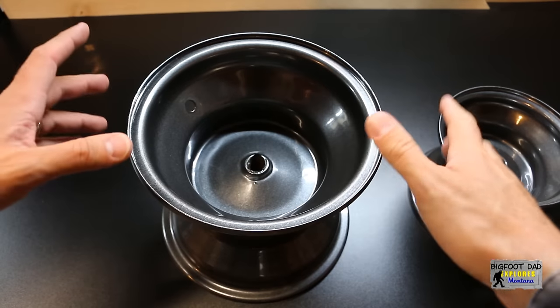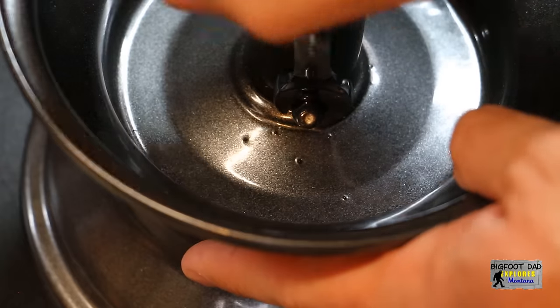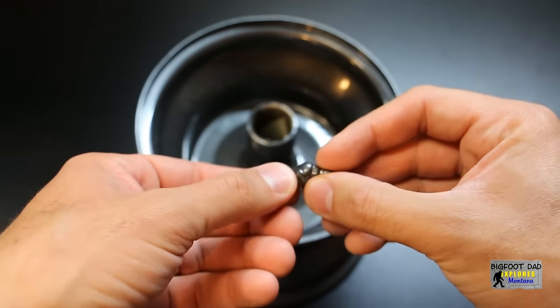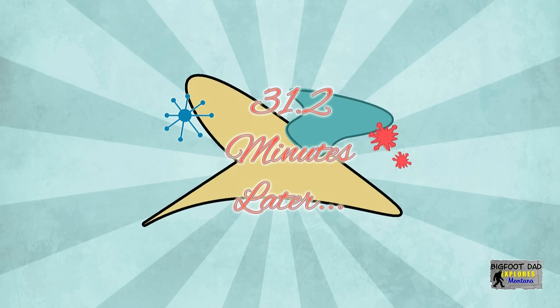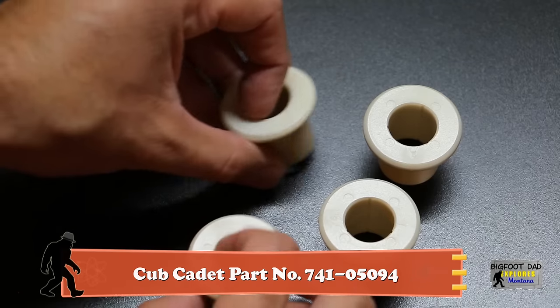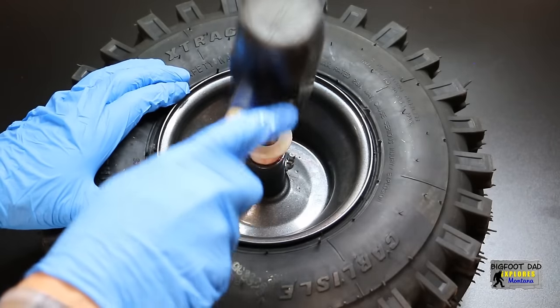Just look at these things — these are absolutely beautiful. I cannot wait to get these tires on and have a better look. For the wheels, let's change out the grease fittings since they were coated too in the process. We'll score the coating with a razor blade right where it needs to separate from the base. It seems these fittings are not threaded, so they must have been pressed in. However, I picked up a set of threaded fittings, so let's see if we can get them to self-start into the existing holes. Well, that certainly escalated quickly. So I took the wheels to TKI CNC — they figured out how to get a new set of fittings pressed into the wheel and saved the project from the brink of disaster. For the front wheels, we'll also need to install a new set of bushings — ordered these straight off the Cub Cadet website. We'll need four of these, two for each front wheel. We'll carefully persuade these back into the front wheels.